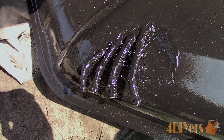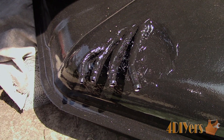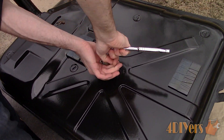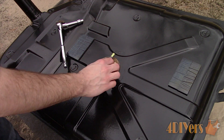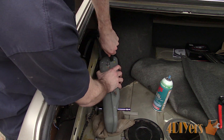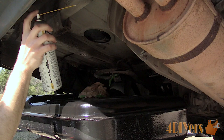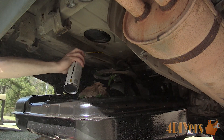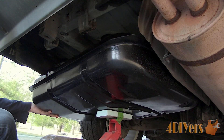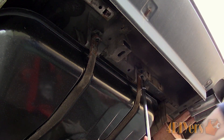Here's a view of the repair before the tank is lifted into place. I installed the fuel pump to prevent any dirt from dropping inside the tank during installation. Install the tank in reverse of removal — if you have a built-in drain make sure it's tight before filling with fuel. If the tank straps are in rough condition, purchase replacements. Replace any fuel lines as needed, and new single-eared pinch clamps were installed along with new bolts on the tank straps. As a final step, spray a rust-inhibiting coating such as an oil or wax spray to prevent future rusting on the tank and the bottom of the floor. Once everything is done, fill the tank with fuel and check for leaks. The last time I did a repair like this I put over 50,000 kilometers on the car over two years without any issues — it's certainly a much cheaper route than purchasing a new tank.